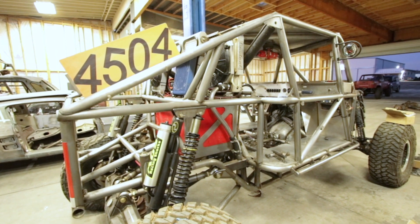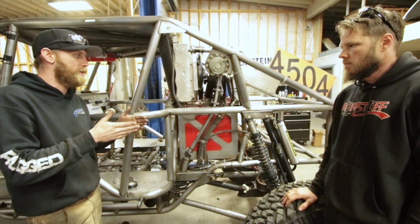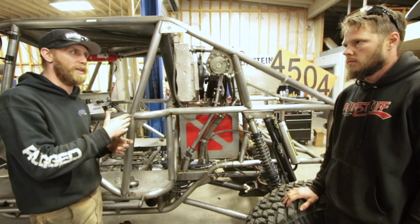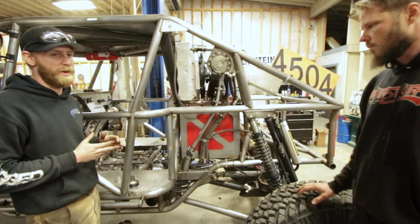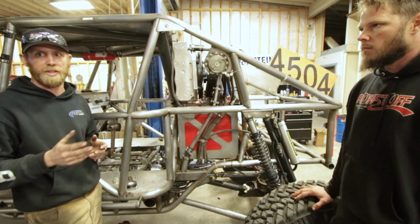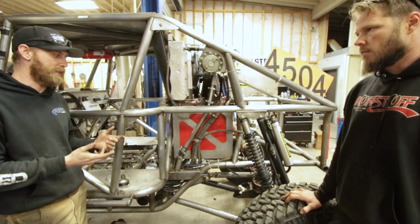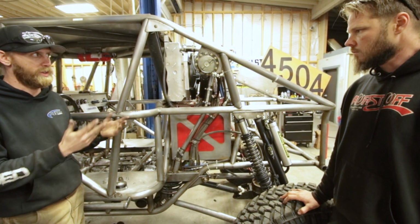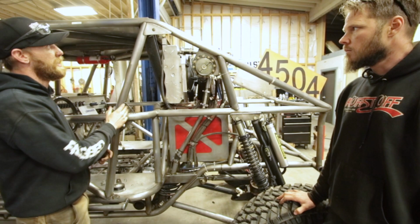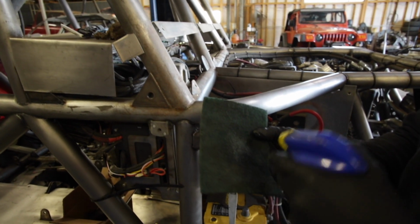Especially on a brand new car, you make small changes and tweaks. You find out there's something rubbed here or something needs to be moved there. Well, if you have a fully painted chassis, you'll be grinding all that paint off. Especially a lot of guys, they'll get these things powder coated. Powder coat sucks to grind off, clean, and then touch up later. Right, it just looks like crap. But if you've got a couple of years in it, and you know everything's going to stay where it is, then yeah, go ahead and paint it, and it looks nicer. I mean, some people, I kind of like the raw look. Sure, that looks great. A lot of Scotch-Brite and WD-40.